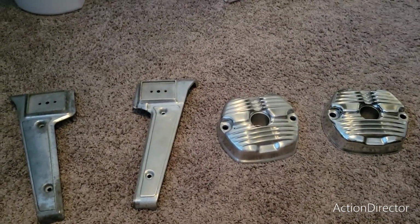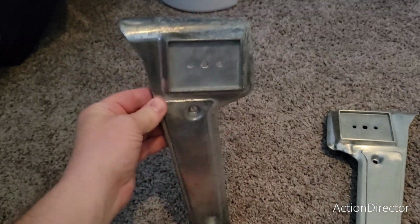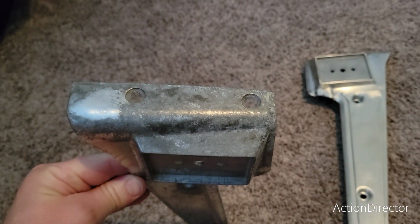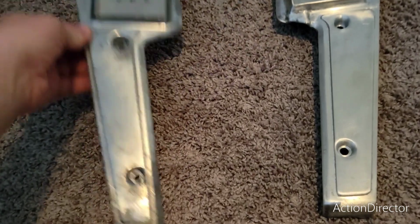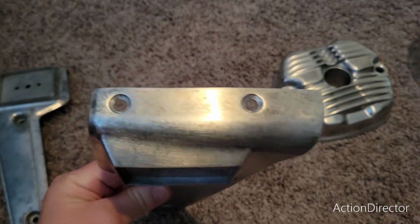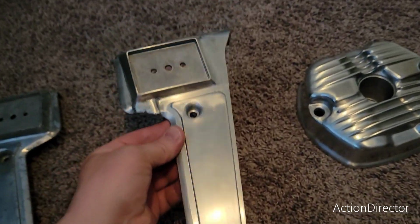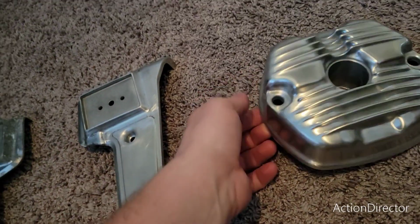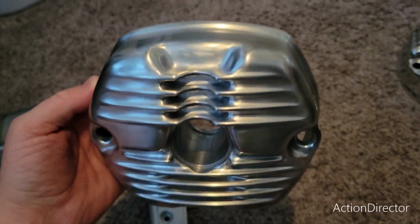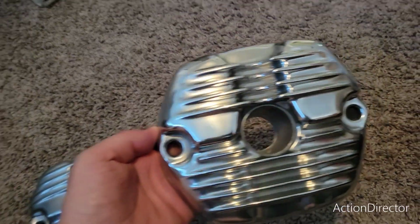All right, so here's where we're at. Fortunately, I kind of have a progression of events. So this is kind of the start right after I stripped the clear coat, so you can really see the crusty. Then I moved on to this one that I did with 220 grit. Better, still very pitted, a lot cleaner though. Then we have this one, which is down to 1200 grit, so looking good.